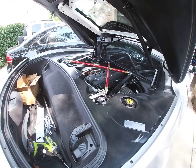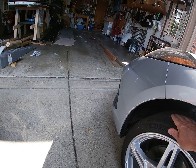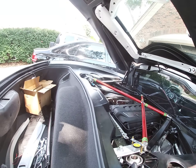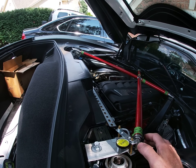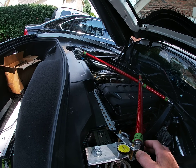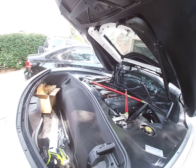So now we can see we're up on the ramps and the front left is all the way off the ground. We're putting a pretty good torsional load across the chassis and we can see our dial indicator has moved. I don't know exactly how much at this point, but it looks like a couple millimeters — I'll have to look at that more closely.